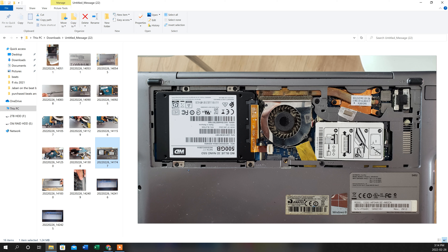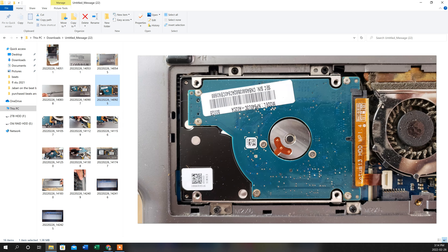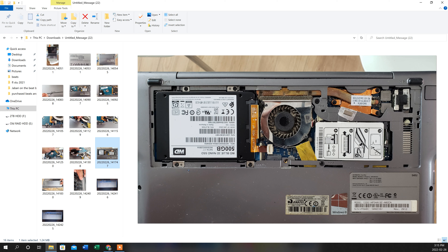My customer's new drive is a 500GB Western Digital. Make sure you don't put the drive in backwards — if you have the wider power connector end of the drive flipped upside down it will end up the wrong way. Match the orientation to the SATA cable: wide section at top, narrow section at the cable side. If you can see the label and serial number facing you, you've got it done right.